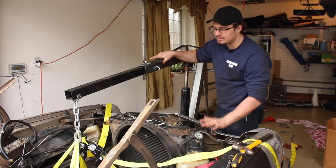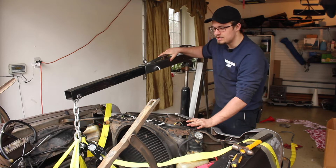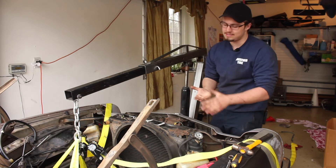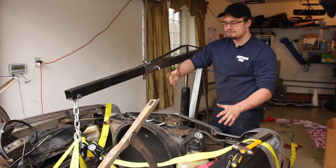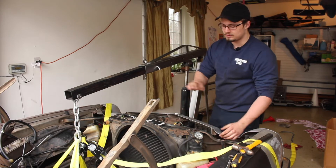What I've done here is hook up all the straps and pump up the hoist a little bit so that not all of the weight is pushing down on the bolts inside the mount. It'll make it a lot easier to take the bolt out and free up the engine, because the last step is to take the bolt off the mount.